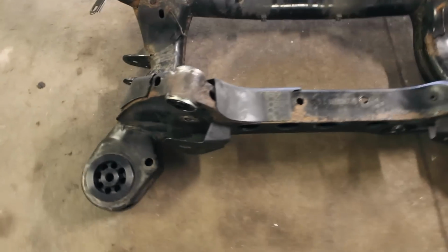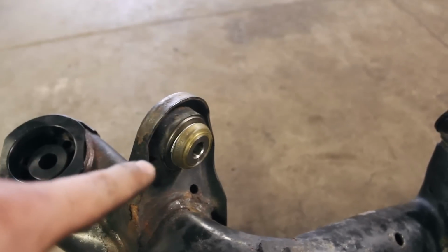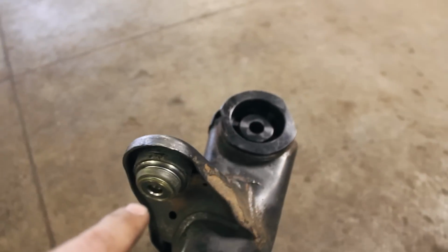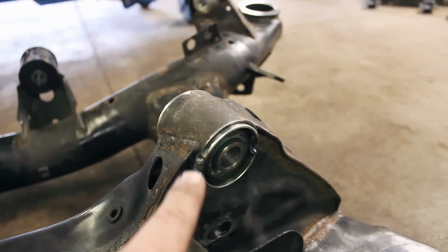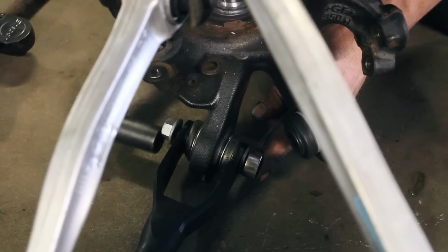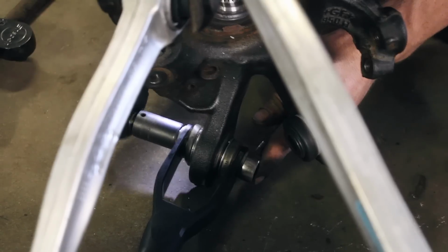And we just got all the bushings, bearings, and mounts pressed into the subframe. So this is the trailing arm bearing, solid rear subframe bearing, the black poly two rear diff mounts, again the trailing arm subframe. This is a rear camber arm bearing, the Bimmer World unit that we had a tack weld on, solid subframe, same thing on this side, and then the last bigger poly diff bushing. So all the old stuff's out, and now we're gonna go ahead and work on attaching all the new arms and other stuff to it.